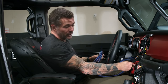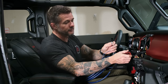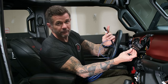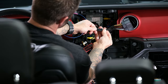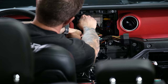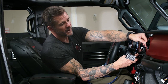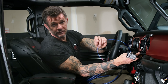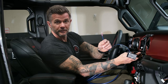This nine wire will route up through the glove box behind here. We're simply going to attach the connector that we provide to the black connector on the pack harness. Then this is going to attach to the back of your head unit, and this is going to attach to the main harness coming out of the Jeep. This blue wire is going to feed back down to that same channel and attach to the blue wire next to the pack module that has the female bullet connector to match up. So that's the pack install.